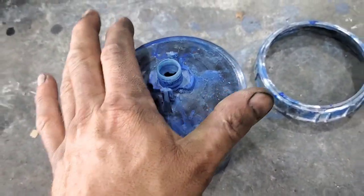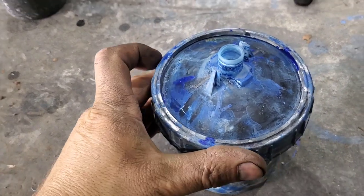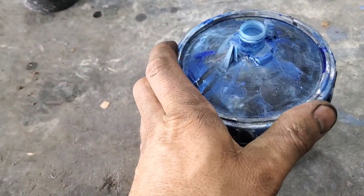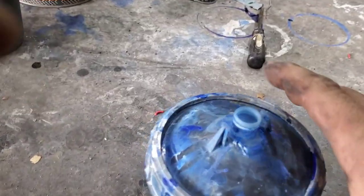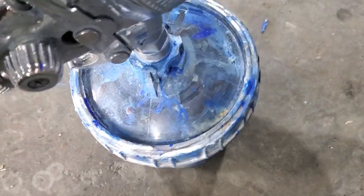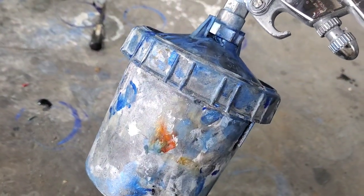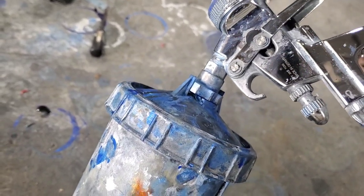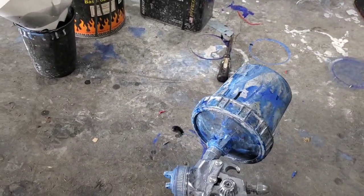This cup right here - I think it's 3M - it's pretty awesome. There is a baggie inside of here and you're basically sucking the paint out of a bag - it's a fully enclosed system. This locks down on there and you can spray upside down. I screwed that down tight and fit my gun to it - just a quarter turn and it locks down in place. With it upside down, you put your air on, hold your trigger down, and it'll pull all of the air out of that baggie. Then it's fully enclosed and you can spray upside down and it'll never skip a beat.